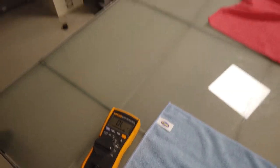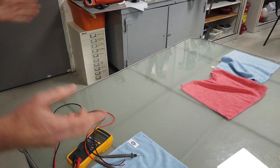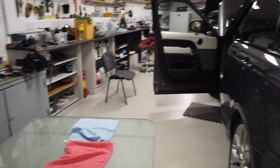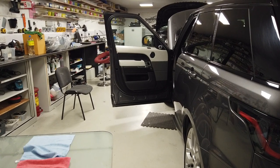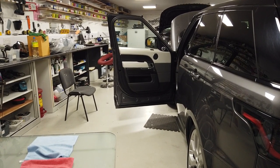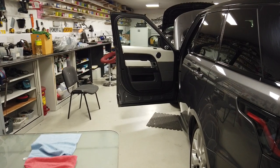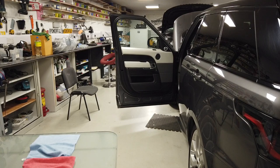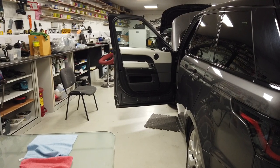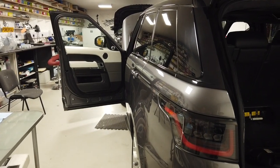So that's one way to test. We're nearly finished. When you have a front crash it deploys your passenger airbag and driver's airbag, and your seat belt, depending on whether you've got a passenger in there. But if you have a side impact it doesn't deploy the driver's airbag. We've changed the steering wheel and the steering wheel airbag was all good.